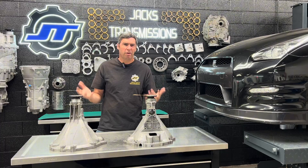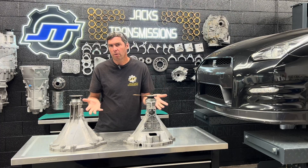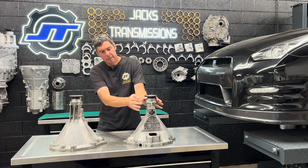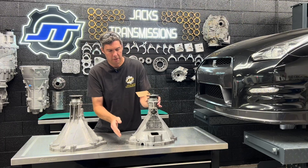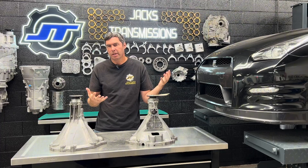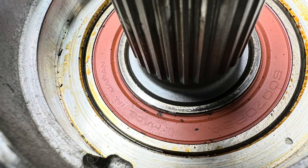We've been rebuilding these for a long time. We really don't advertise it much, but there's a lot of misinformation out there, a lot of confusion as to what's going on with these. So we thought we'd clear a few things up here and show what we offer in our rebuilds compared to what maybe other people are offering in the industry. With the CBA bell housing, you have a pair of bearings — a bearing on this end of the shaft here, another bearing on the engine side of the shaft on the inside. It is a sealed bearing, has its own grease in it — a maintenance-free bearing. It's supposed to last the life of the vehicle, but as we all know, it doesn't.